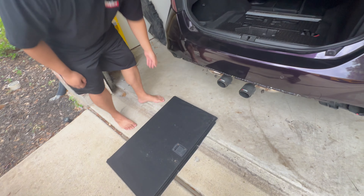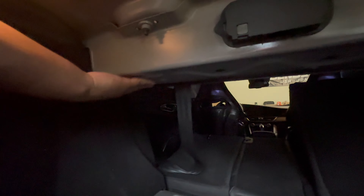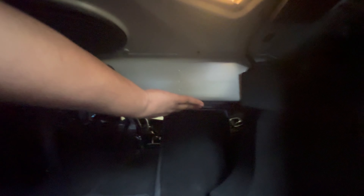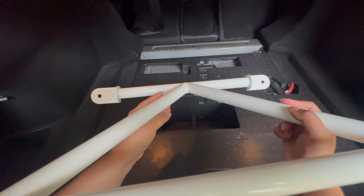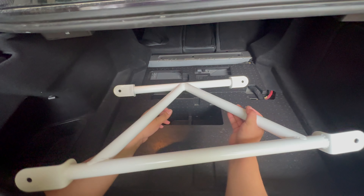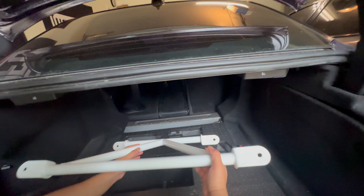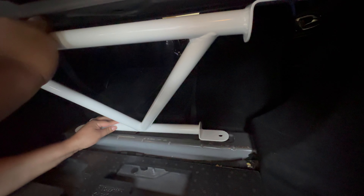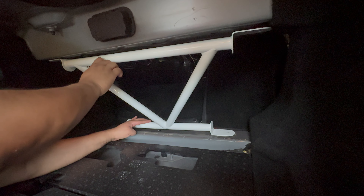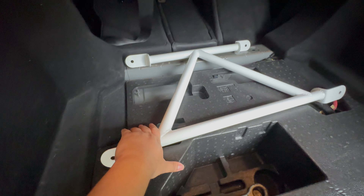If you're looking to reduce body displacement by 18%, first you're going to open the trunk and pull out your carpet. You'll start with two clips — one right back here and one right over here. Pull those out. All you really need is a rivnut, and you pretty much just bolt this thing in. You're going to rivnut into those two factory holes back there, and then we're going to drill two holes on top. It should sit something like this once we're done.